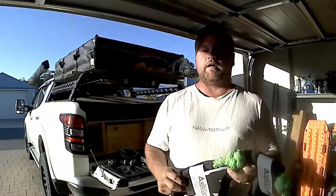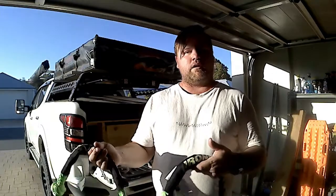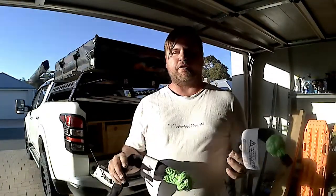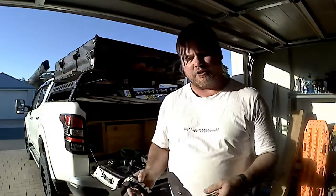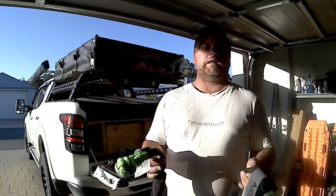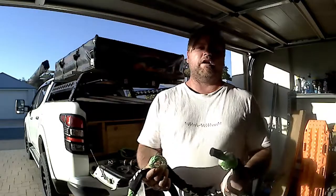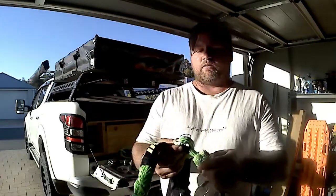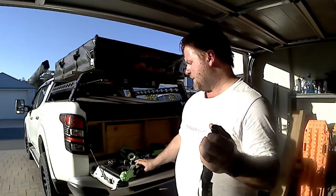The main reasons people go for soft shackles nowadays are weight and safety — those are the two big keys. Weight-wise, they're very light. With carriage, two bow shackles don't really add a lot to your payload, but when you're trying to set them up during a recovery and doing the pin without dropping stuff, the lighter weight of soft shackles can make things a bit easier. And being one piece means if you drop it in water or mud, it floats and you can still use it.